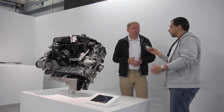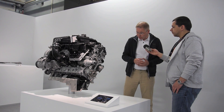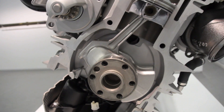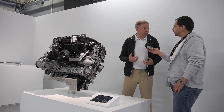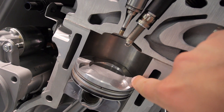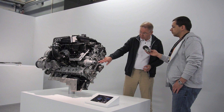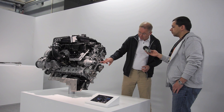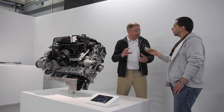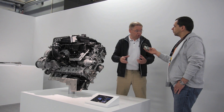The engine is smaller obviously — what else? We did quite a lot inside the engine. We made a new crank housing, tried to make it as light as possible on one hand side and as stiff and robust on the other. For example, we designed it with a closed deck design. That means the water area here is not opened to the deck or the cylinder head — it's closed. That means you don't have a U-profile that you are twisting; you have a closed O-profile and it's much more rigid against torsional load.